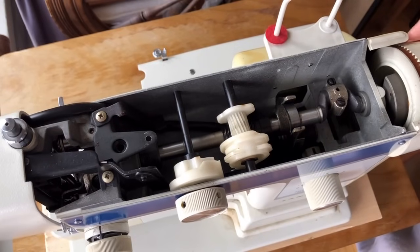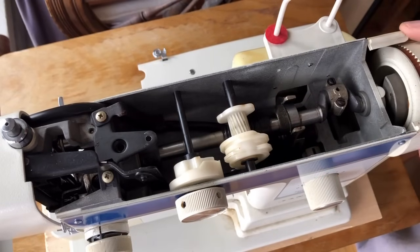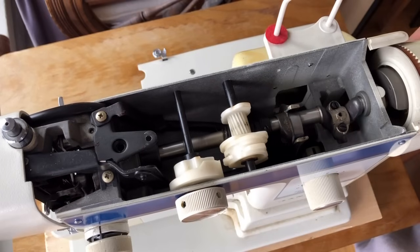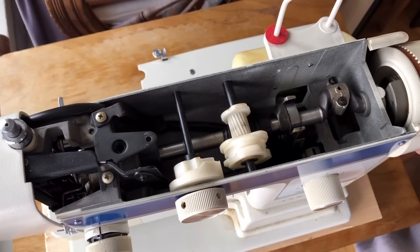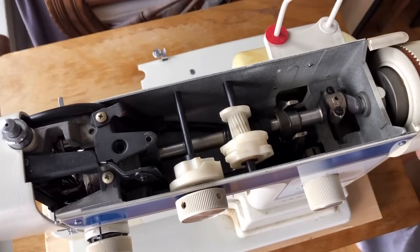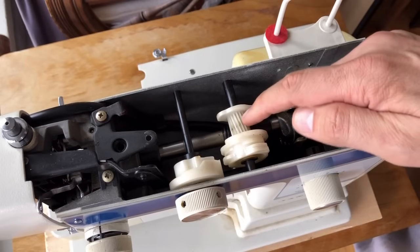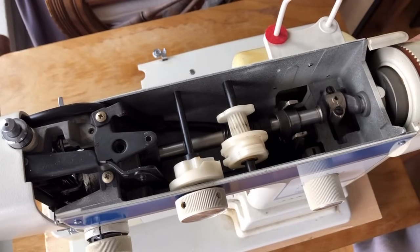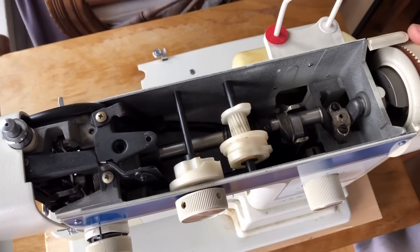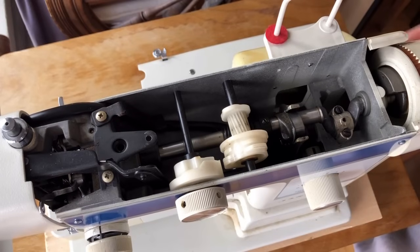Pay very close attention to these cams and to this gear. Okay? And what you want to do is look for cracks. Generally, if these gears discolor, it's usually all over. It's consistent. And look very carefully, and you may need a flashlight for this gear, but look at it and see if you see any cracking. It'll often look like cracks in ice. You've seen cracked plastic before. You probably have some idea.